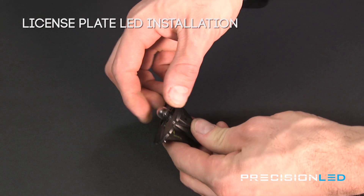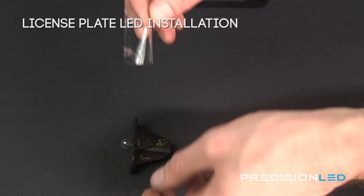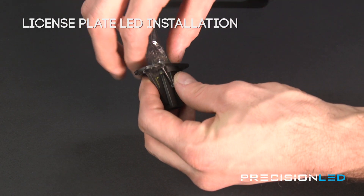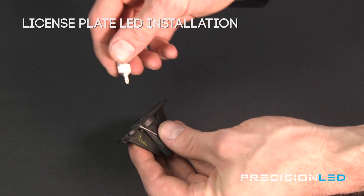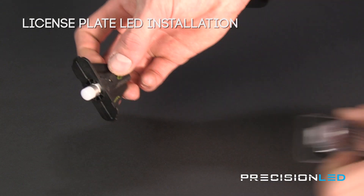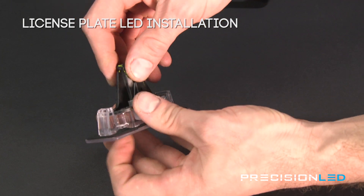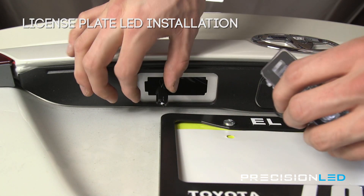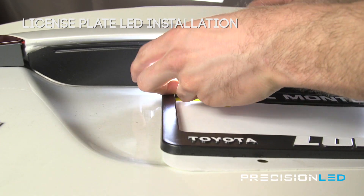You could try to remove the bulb with your bare hands but it can be a bit difficult. A trick to get the bulb out more easily is to take a piece of tape, make a U shape, wrap it around the bulb, and then yank the bulb out using the tail end of the tape. Here we have our LED — just pop that in. Again these are non-polarity specific so you can pop it in any orientation. Reassemble the casing exact opposite of how we disassembled — line up the tabs and twist clockwise until it snaps into place. Reconnect the power connector, confirm everything is working perfectly, then pop the lens housing back into the vehicle.